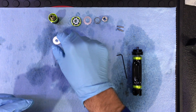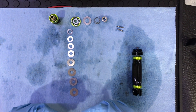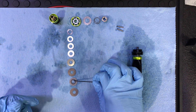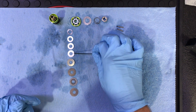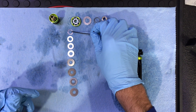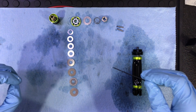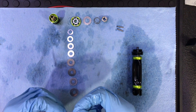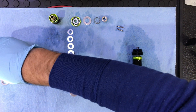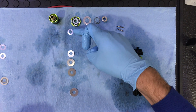Now we're going to work on our shim stack. Once you lay out the shims in the order they're installed in the fork, you have the platform shim which goes up against the face of the piston, a ring shim with a centering shim — the centering shim just keeps the ring shim from sliding around. Then you've got a few shims used for high speed compression, and then the clamping shim which is used mostly just to hold it all together. When I spoke to Ronnie at DVO, there's a proven modification to the shim stack which allows the fork to work better for less aggressive or lighter riders by reducing the amount of high speed compression. All you do is remove the ring shim, the centering shim, and the top two shims from the stack — not the clamping shim, you want to leave that one in.